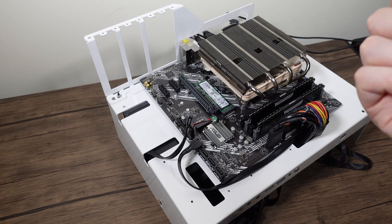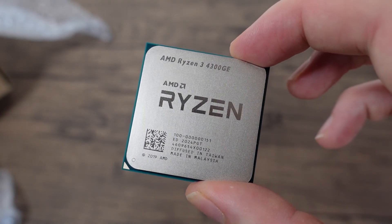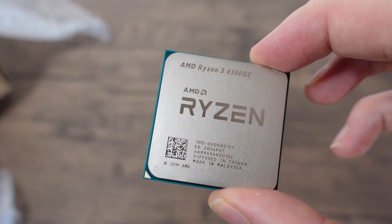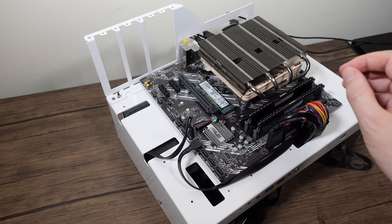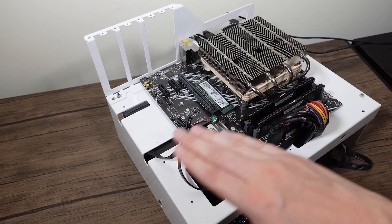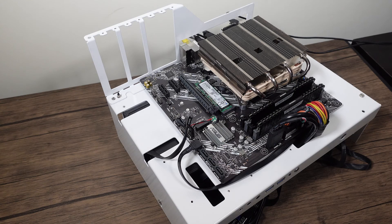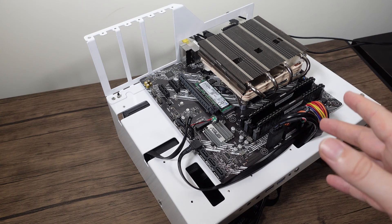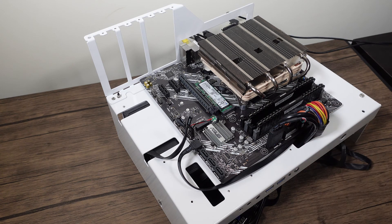So what's the point in paying an extra 20-30 pounds for this CPU over the 4300G? Well, it's that lower base clock — that's it really. There's no reason to get it unless you're looking for a machine with the lowest power consumption. You can turn off turbo and have it sit at around 35 watts, which I'm going to try in another video passively. Realistically it's a bit of a gimmick; the GE processors recently have been kind of a gimmick.